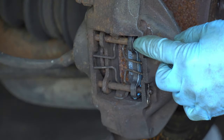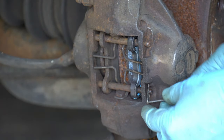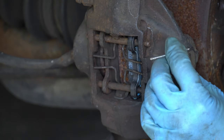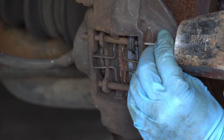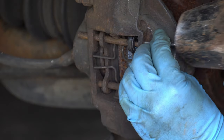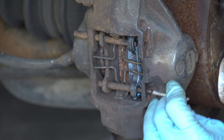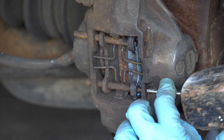First I'm gonna start on the rear calipers by removing these tiny little hairpins. Next you're gonna want to find a teeny tiny little pin like I have here. Thankfully I have lots of little rivets left over from my Exocet project, so this was perfect for that. Gently tap those out and make sure not to breathe any dust that comes off of those. I forgot I need to return Thor's hammer — I did not need to use that big of a mallet on this.